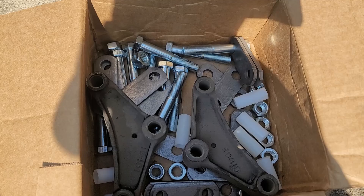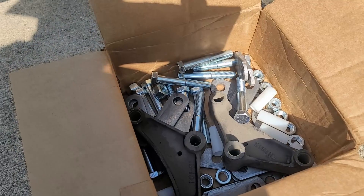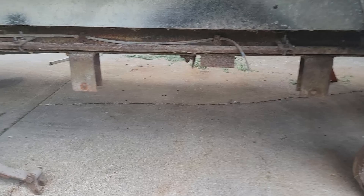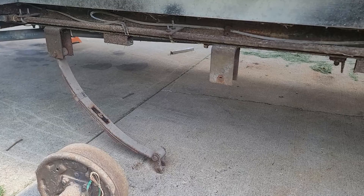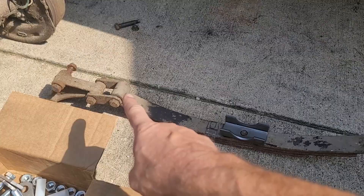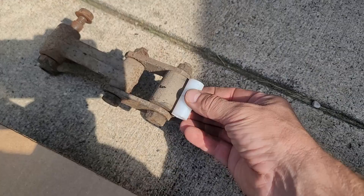All this was actually pretty pricey — it ended up being about $160. The slop that was in all the old parts here was just unacceptable. I'm like, well I don't really want to come back in here and take it all apart later, might as well just bite the bullet and buy it now. It took about two and a half, three hours to go up there, but I had a nice little lunch with my wife and daughter. So we'll go ahead and get some of the new hardware on the leaf springs. I've got to get out the old bushings and push in the new bushings — they all go in here in each leaf spring.